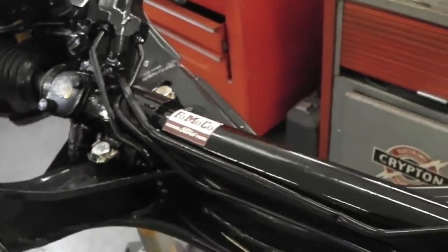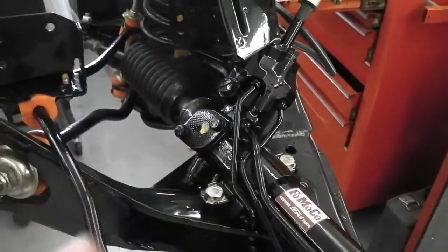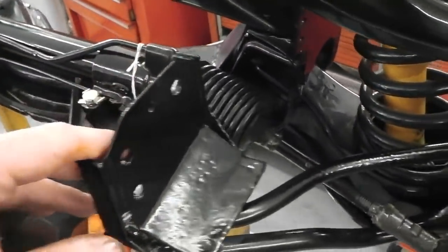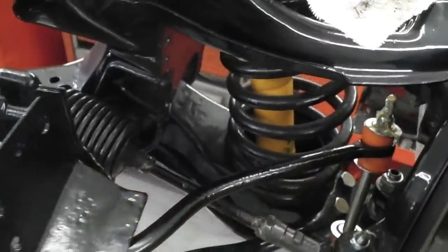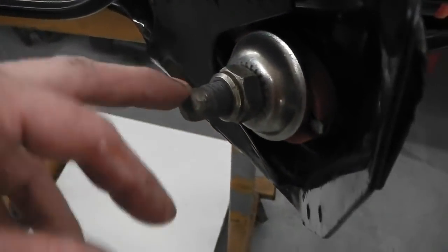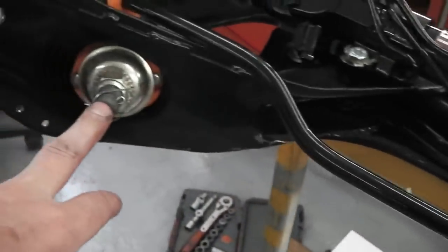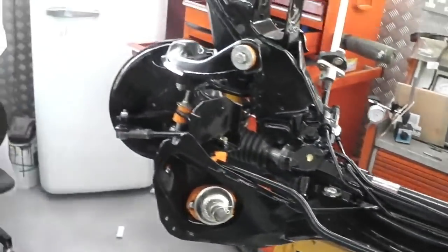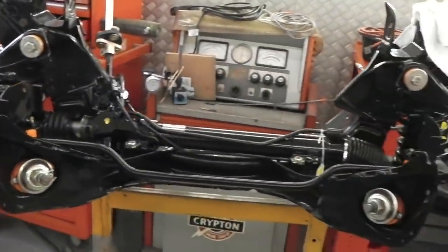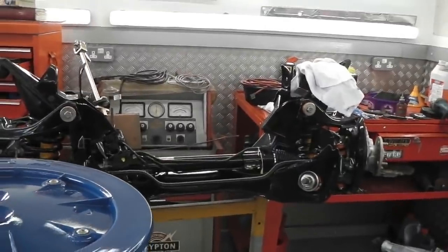I put a Fomoco sticker on because I had one, and as I said, I copied them yellow dots across. I reckon it's an exchange unit. Anti-roll bar front, as I said, with the stabilising bolts. That's about it for the clip. There's a hole to drill in the end of here because the split pin broke inside. It was that rusted, so I'll re-drill that one out. That one's done. I put gal split pins on. A couple more split pins to fit. I've had them galvanised so they're nice and rust proof. And that's about it. We can really start getting closer to the job now that's done. And cover that back up and leave the clip till it's needed.